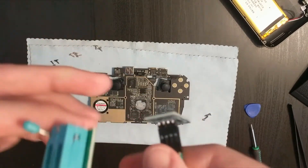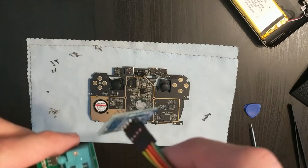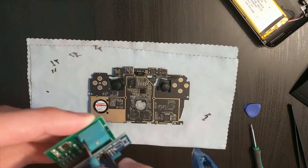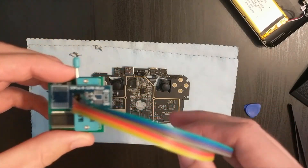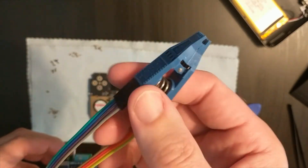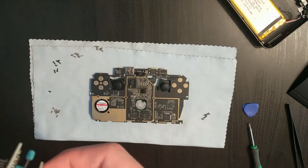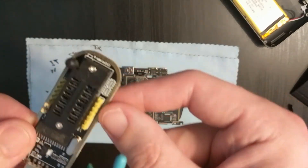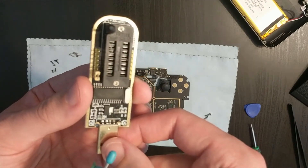It's very important that you get the correct pinout. On each of the boards it identifies what pins 1 through 4 are and 5 through 8 are. If you don't get this right, your BIOS software on your computer is not going to be able to recognize the chip and you won't be able to reprogram it. Here's the actual USB reprogrammer — this is what you'll plug into your computer and use to re-flash the BIOS on your GPD Win.